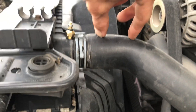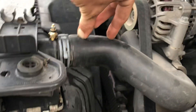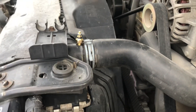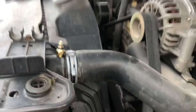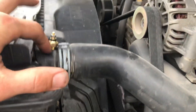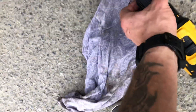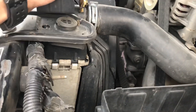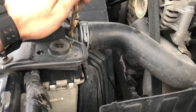I literally just finished this and already tested that it doesn't leak — no Teflon tape required. If you don't want to waste the fifteen dollars on that fancy-looking piece you absolutely don't need, and you just want to get your gauge installed, tap in right there. The drill bit size I used was eleven thirty-seconds.